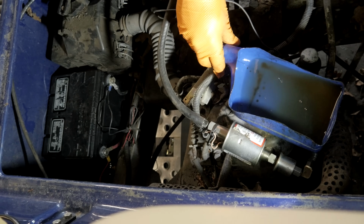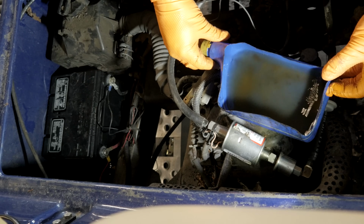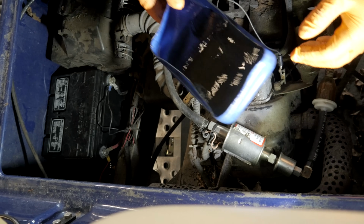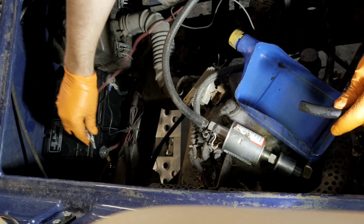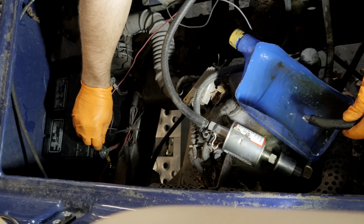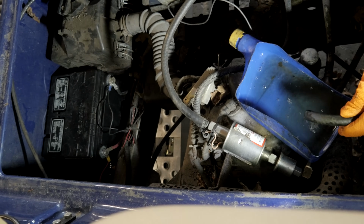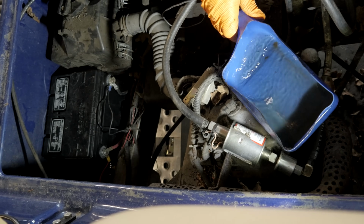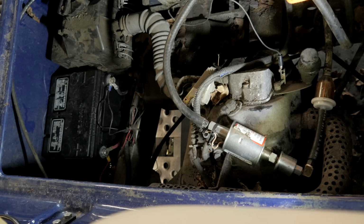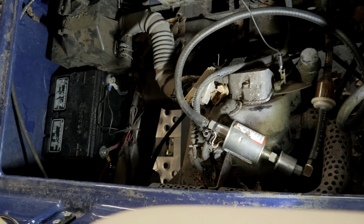Okay. So now the fuel system has been primed. But you can see, look at all that yellow stuff in there, it's basically algae and slime. And there's water in it too. Mostly water. Alright, so we'll go back to positive here. Now we're also pumping through from the cart's pump. So that's much better looking. It's still kind of gnarly, but it's definitely better. It's also mixing with a little bit of oil that's in there, but it's still got like a hazy film to it, so it's not perfect by any stretch.